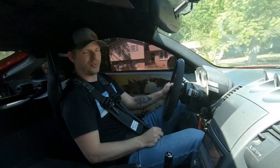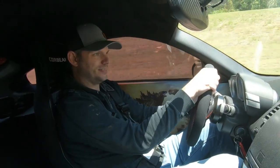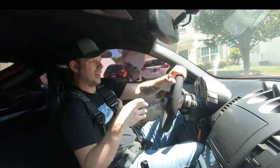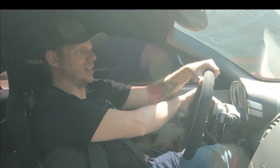If nothing else, your 350Z right now is probably just worn out anyway, so it's worth the upgrade just in that regard. The good news is there's no extra vibration and no extra weird noises. We did have a little bit of wheel hop, but we've got a bunch of other stuff going on in this car — the coilovers are old and were probably beat to hell by the previous owner. More importantly, we have a trans mount and motor mounts we need to deal with, and all that movement in the driveline doesn't lead to good launches. When we rolled into it and just chirped the tires and hooked up, that was perfect. I feel like launching at 2,000 RPM might be a little too low — maybe we're not getting enough wheel speed and wheel spin. But overall, great addition.